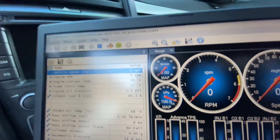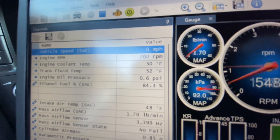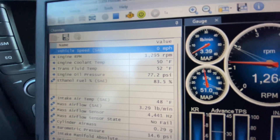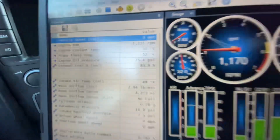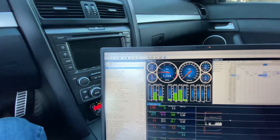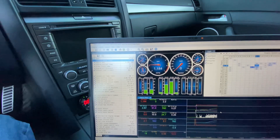This is a cold start — it's been sitting two days. Yeah, almost 80 pounds, 76 now, 75, 74. I'm going to get the oil changed real quick and then I'll show y'all what it's cranking cold with the 5W-30 just for comparison. Going to get the car jacked up and get this 5W-30 in so y'all can see the difference. It feels good this time — went from not enough oil pressure to having too much.